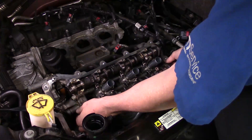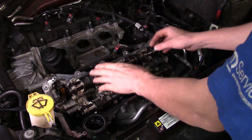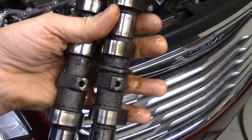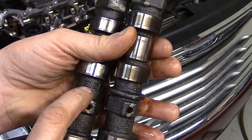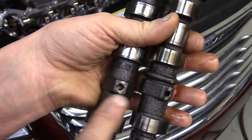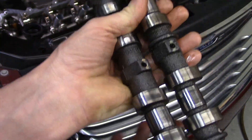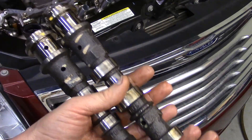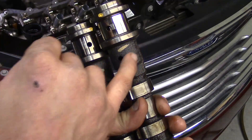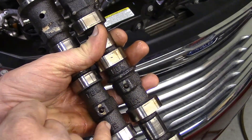Now we can grab each one of the camshafts. I like to keep them separated and know which one's the exhaust and which one's the intake. If you're worried you got them mixed up while you had it apart — cast into the camshaft is a number that says 3.6L for the engine size. Right above the slope there's 'LE' — L stands for left, E for exhaust. The other one has 'LI', so that's your left intake. There are markings cast in there; if you get them mixed up, look close. Or you can put a paint mark or letter, I or E, whatever works best for you.